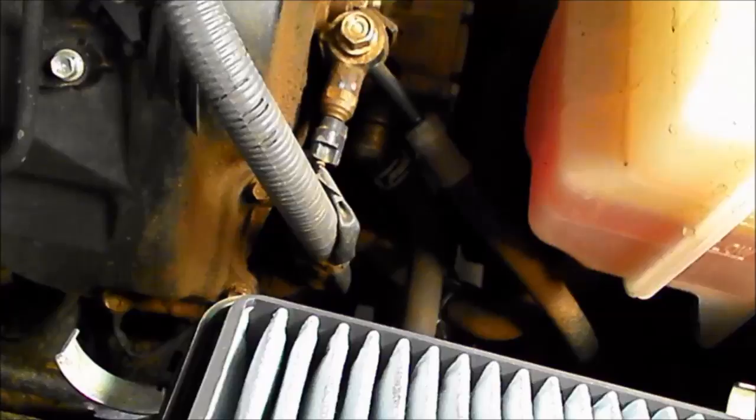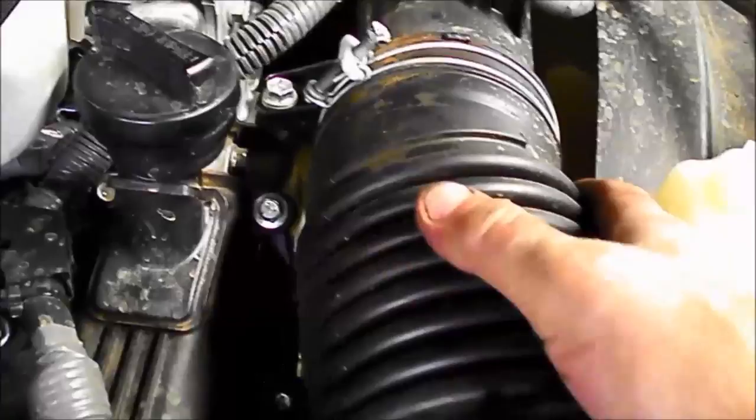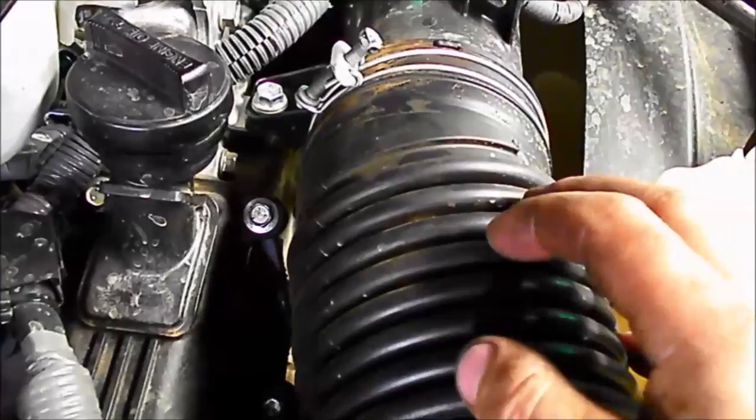Make sure there's no rubbish going in there. There's a little bit — you can see a little bit of carbon as I scratch there with my finger. We'll put the air filter cover back on and top it up with engine oil. Something I forgot to mention — the air filter hose here, they do sometimes get cracks in there.